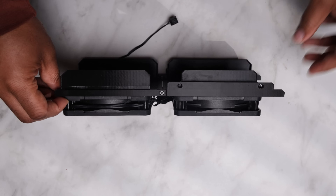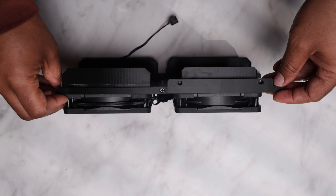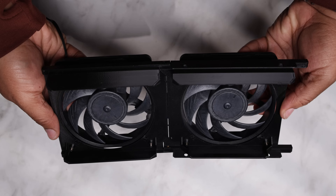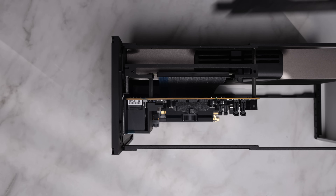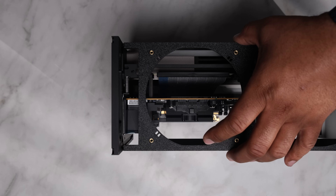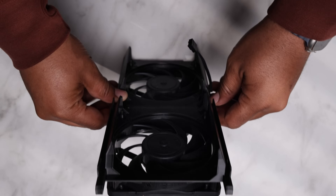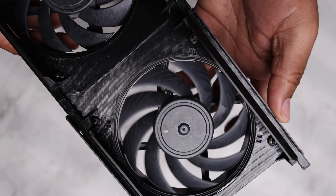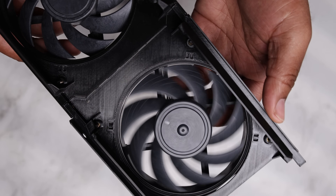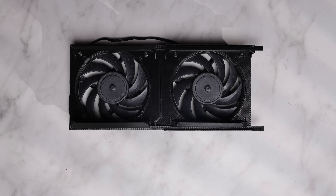I reviewed the new exhaust shroud version 2 from AGA, which offered great improvements design-wise and a small bump in overall thermals, with improving compatibility with more motherboards like the Asus ROG X670E-I and now this Aorus B850I Pro. Shallow scoops help in that regard along with reducing the amount of structural support, however it remains sturdy — but this may vary depending on what filament material you use, preferably something heat-resistant like PETG.